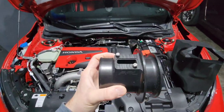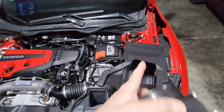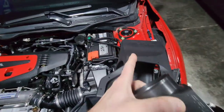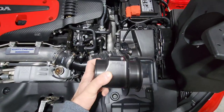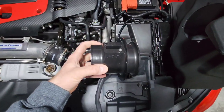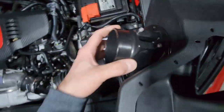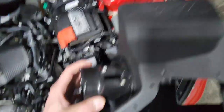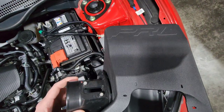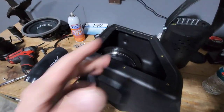You're gonna want to make sure you clock your MAF housing correctly — that's pretty simple. Basically your box is gonna sit in like this for the PRL; your MAF sensor is right there, so you want it to line up so it goes in the same spot. You just eyeball it — your MAF opening is going to be facing the PRL. Pretty easy.